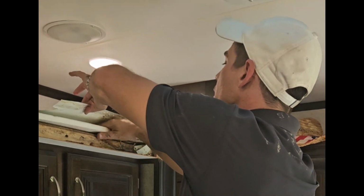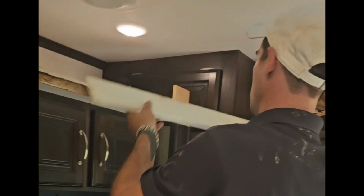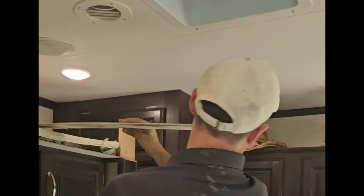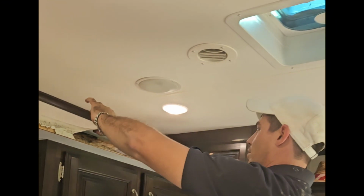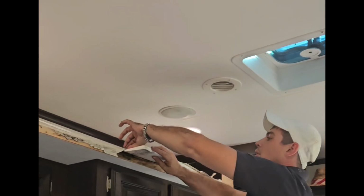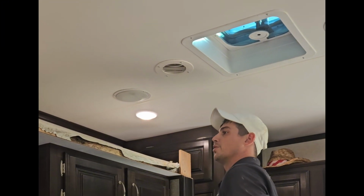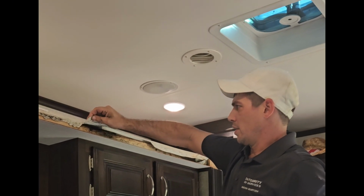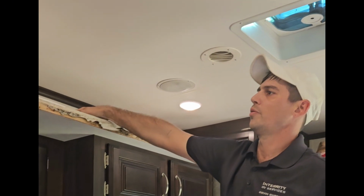What did they do here? So this is what was supposed to keep your water inside, or from coming inside. This little slant. Wow. That's what they were expecting. Great. So, in lieu of sealing this with butyl and a piece of metal trim over the top of it and folding this back for a pillow seal like they've been doing for years and years and years, they said, let's just put this little piece of styrofoam, glue it all together, and hope for the best.